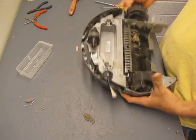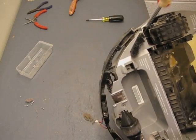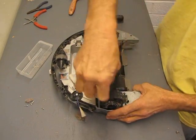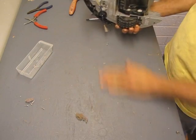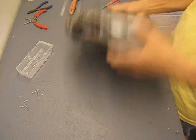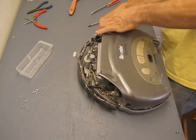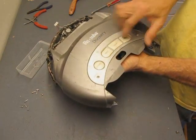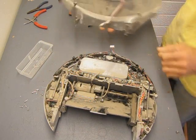We've got those screws removed — there's two more to go. One is here by the wheel on this side, the other one is right over there. Those are the last two that hold down the top cover, so let's get those out. That should be all eight screws total. The cover lifts off the front — there's a few little clips you'll hear release, just give it a good tug and it'll pop off. There's also a connector for all of the switches on the top that needs to be disconnected at the motherboard. Let's give that a pull and set the cover aside.